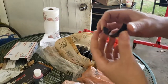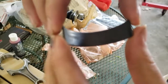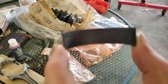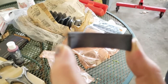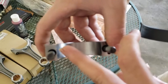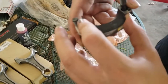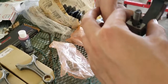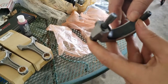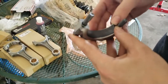All we're going to do next is line up the tang mark — you can see the little tang mark right here — and line that up with the tang mark inside of our connecting rod cap, which is located right there. Simply drop that in, make sure it's nice and seated, locked in there. Push it all the way down. Make sure it's nice and flush on both sides, no gap, locked in the tang, perfectly seated all the way across — and it's good to go.